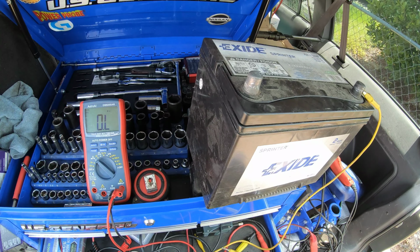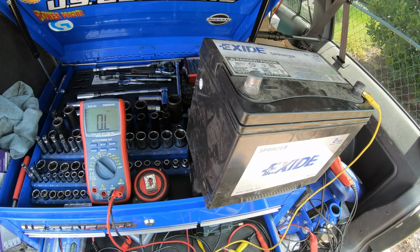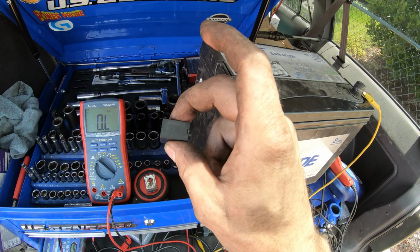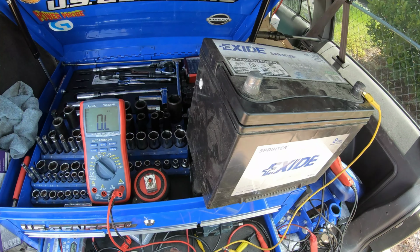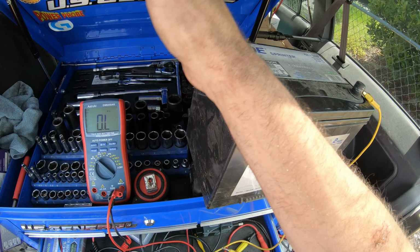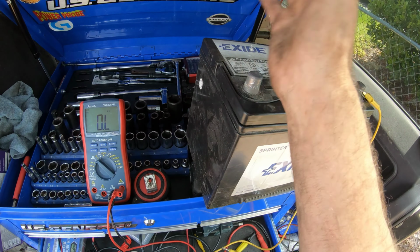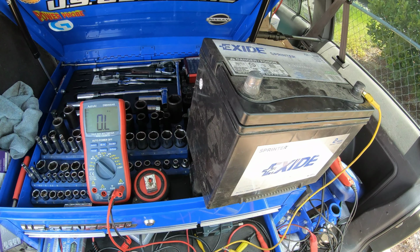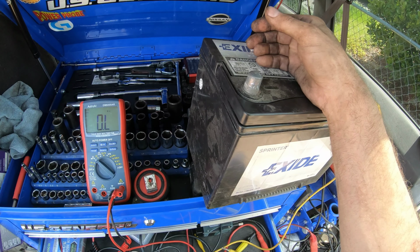And again, it's a Honda common problem that I've seen. The brushes in the motors go bad over time. So we definitely don't want to just pop this in there. The compressor will work, but if the fans aren't cooling down the AC condenser, the high side pressure of the AC is going to get way too high and cut off and on, and it's not going to be cold at all. So we need those fans to be working to keep it where it's supposed to be.